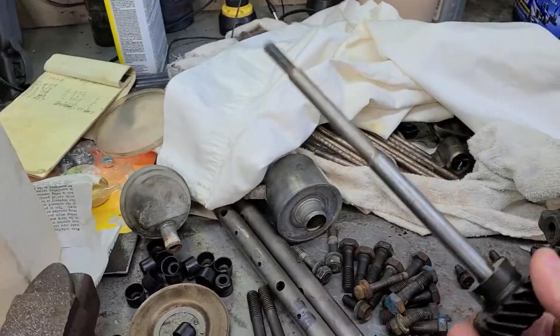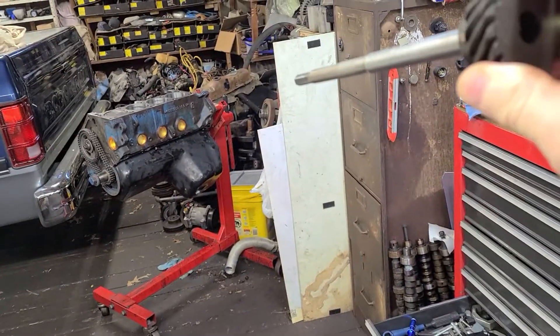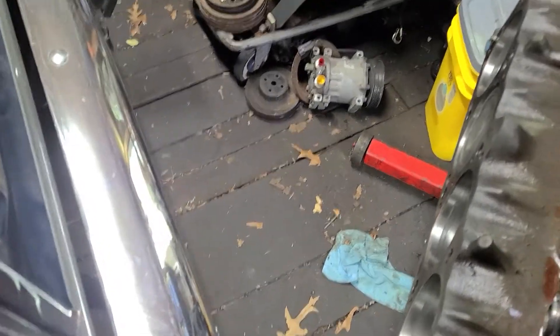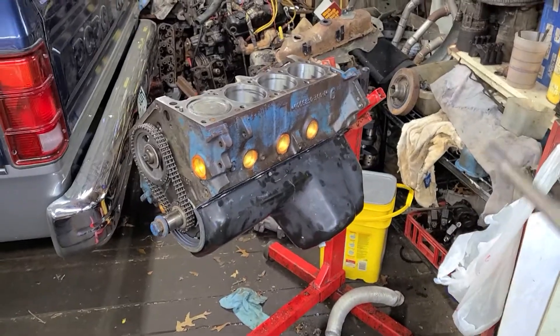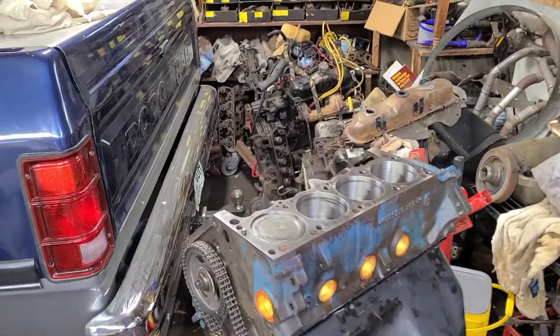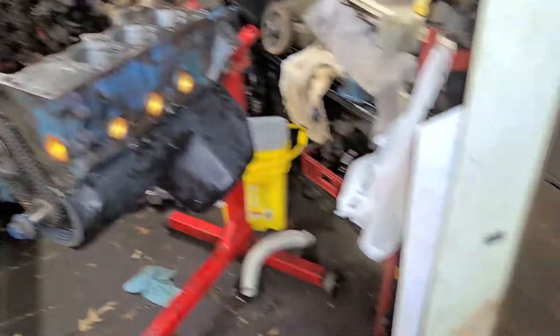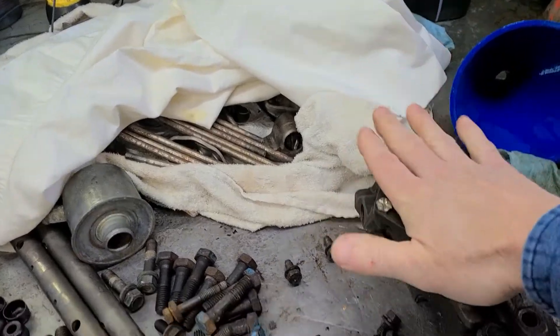One thing I haven't done and I'm not going to do right now is put this in my engine. This is for the 360. Why am I not going to go ahead and put the oil pump drive shaft in? Because I need to prime the oiling system. Oh, I'm about to lose a lifter - right there. So I need to prime that system for that engine. I don't want to put this in and then have to turn around and take it right back out.